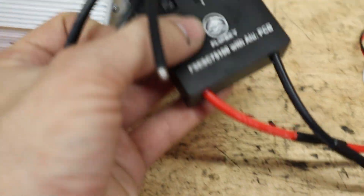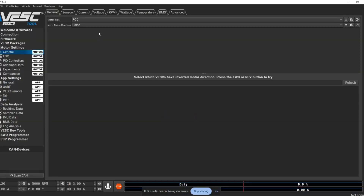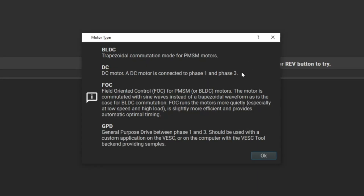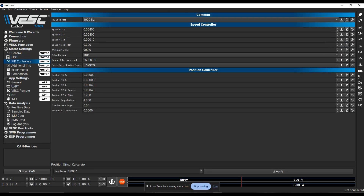By decreasing that flux field, we're able to pull the magnets further faster and allow that motor to achieve a higher theoretical top speed than it should achieve on regular battery voltage alone. It's a bit complicated — you do end up having to put more amps through the motor and it can cause some overheating — but it's a very cool feature for unlocking a higher top speed without changing the battery voltage. This controller can put out more power than a similar-size standard e-bike controller, and it has multiple modes of controlling motors whether brushed or brushless, with tons of user adjustments.